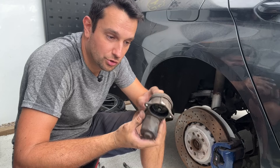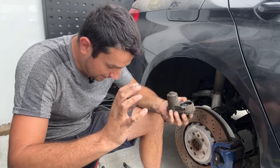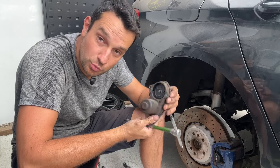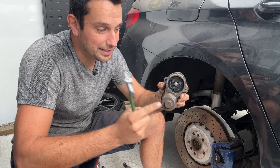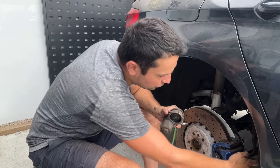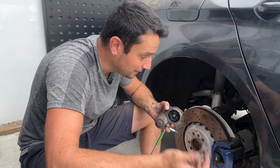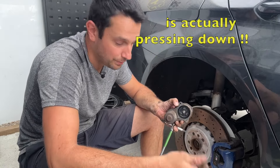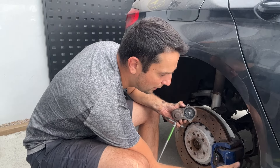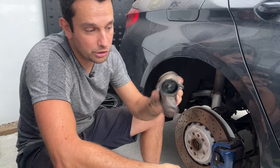This is the motor — this is what actuates your parking brake. It's a 12-volt motor with a couple of gears for reduction, and it has a spindle right in the center which is equivalent to a Torx 45. When you click the button inside your car to activate the parking brake, it sends 12 volts to this unit, the motor turns the spindle one direction, and a screw inside the caliper presses the brake pads against the disc. When you release the parking brake, it sends reverse polarity to the motor, it spins the opposite direction, retracts the spindle, and releases the brake pads.